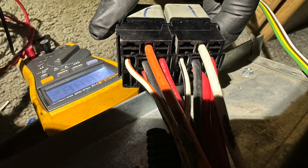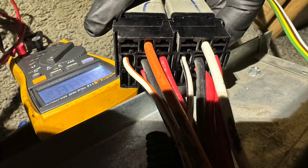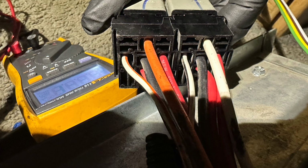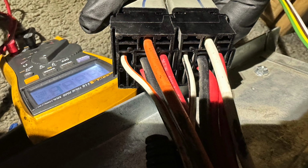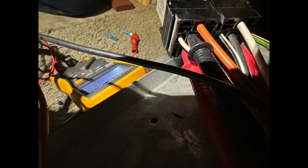You can see this. I have another video I'll link in the description of how this circuit works. As I was looking at it, most of the time they change the state of the relays with a positive signal, but on this one it's a negative signal. I'm glad I checked before I hooked up my tool. You can see the orange and white wire go out to the motor, and the negative is in the center on both of them, and then the positive in is at the bottom. So you're only changing the state of one of the relays to make this thing go in and out.